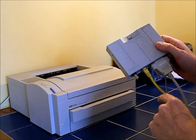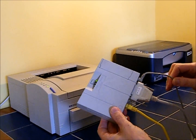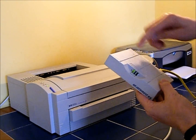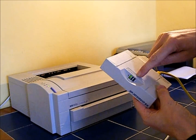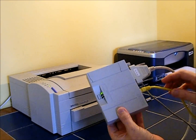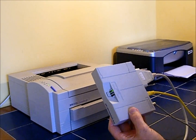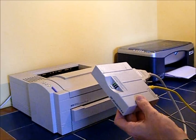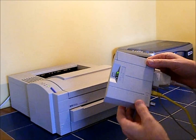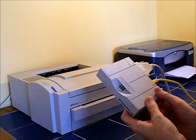As you can see I've got this set up with a connection to the network. The power lead is connected up and the link parallel cable into this HP LaserJet 4L, and you can see we've got a status light on solidly and an activity light in the middle. One thing I found with one particular hub is that I couldn't actually get a proper network connection — it turned out that hub wasn't giving link beat, which is probably some sort of early heartbeat set up on UTP. I tried a different hub and that worked fine, so that's just something that might be useful.